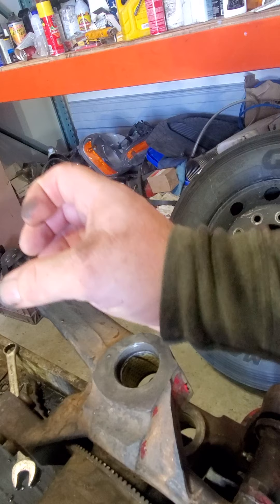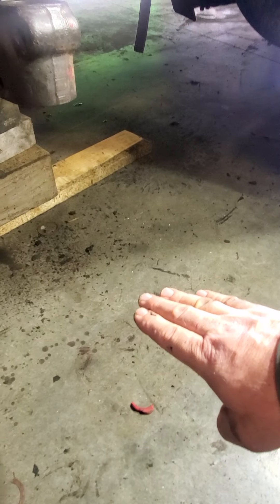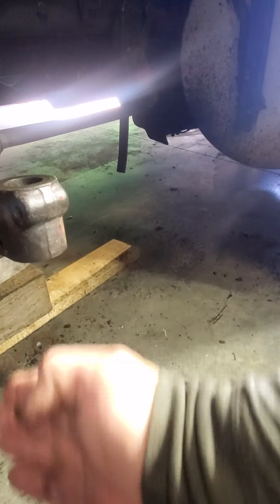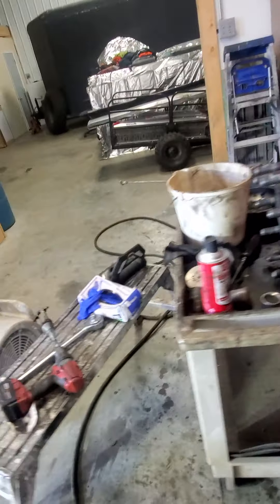When you insert your kingpin, I'm actually going to start it up on my cart here. I'm going to start it here because the guys on the videos were starting it on the bottom. Like I said, once your housing goes on and the kingpin is in, my bottle jack is tall. So that means I've got to jack this truck up another foot - I'm not doing that because it's going to be more on an angle. You have to get that bottle jack directly in line with the kingpin.